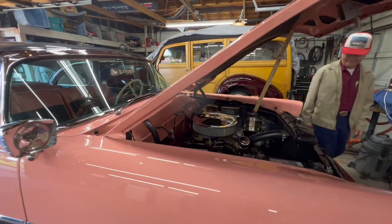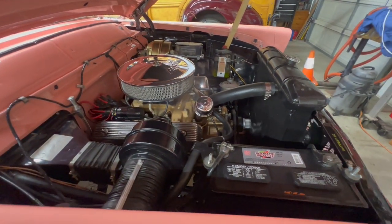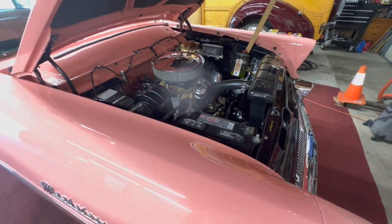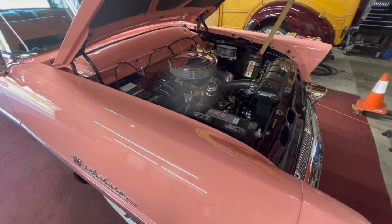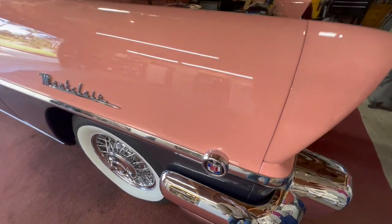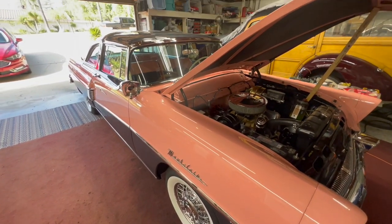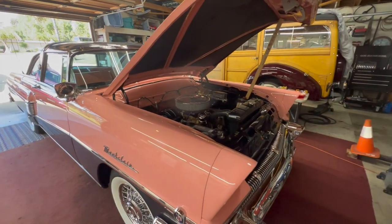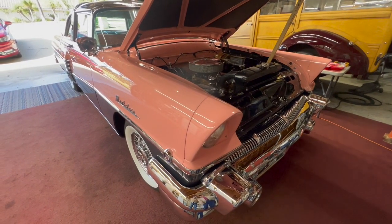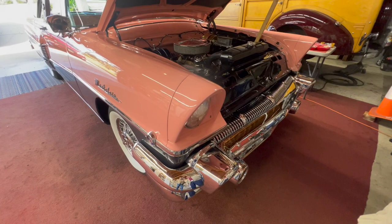Now it's really idling down. Running on the freeway, between 35 and 45 it's got a little bit of vibration — seems like it's in the driveline somewhere — but after it gets up to 55, 60, 70 it's all smooth. I've got a brand new driveshaft made for it and put a second harmonic balancer on it, but it's still got that little bit of vibration. Unless somebody tells you, you don't notice it.